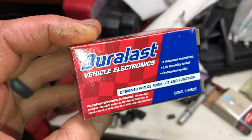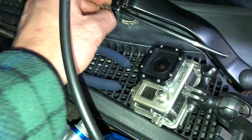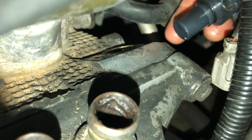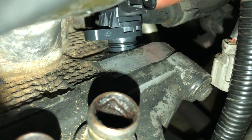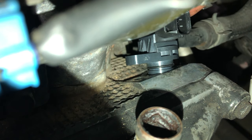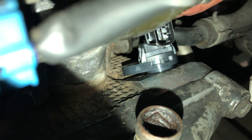I went down to my local AutoZone and picked up a Duralast one — it has a limited lifetime warranty, so if anything ever happens to it I can get it replaced for free. Let's attempt to put this thing back in. Getting the 10-millimeter mounting bolt in is not easy. Once the sensor is in the hole, that becomes your next issue. Feed it back in — it'll only go in one way because it only came out one way. Why is putting it in way easier than taking it out? Just kidding, it's not in yet. Twist it until you can feel it has the clearance it needs, then slowly work your way in. Yes — successfully got it out and back in on camera!